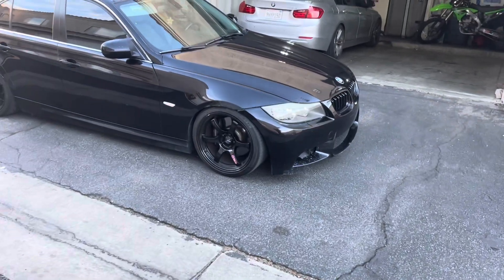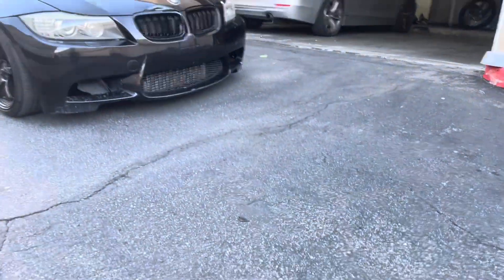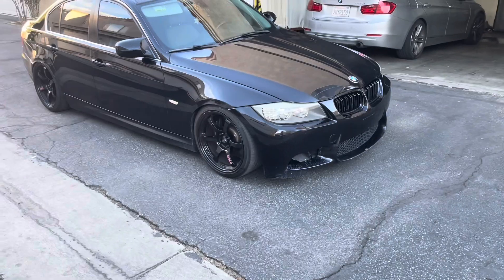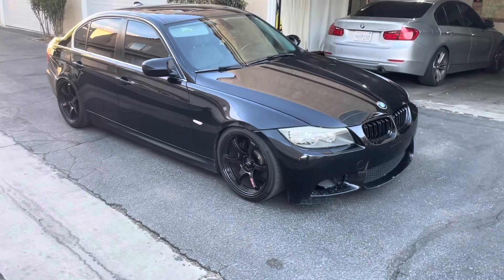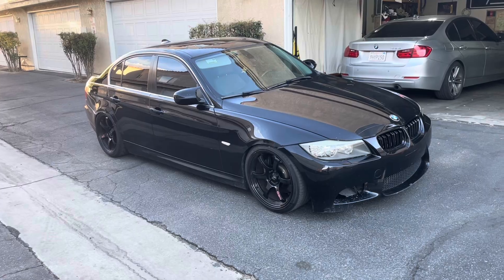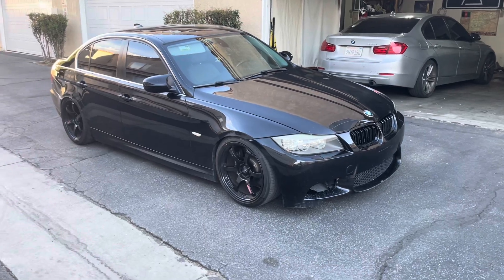The main idea of the video was to show what exactly needs to be done to retrofit an N55 or N54 intercooler into the 335d, and it's really not hard at all. It completely bolted in fine — I just used some studs from Home Depot to make life easier, slipped it on, threw flare nuts on it, and that was it. It took a little manhandling but all the intercoolers on these things do. It's been about two and a half weeks, I daily drive it about 25-30 miles each way, rip on it regularly, and it's been super solid.